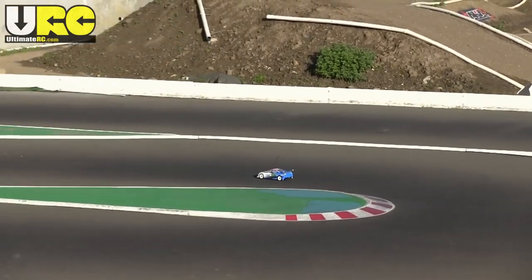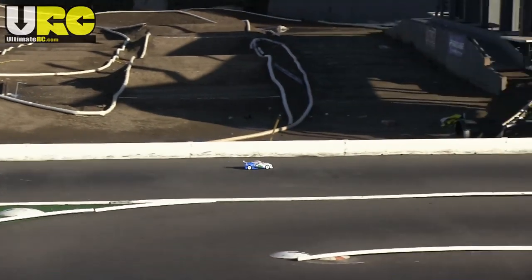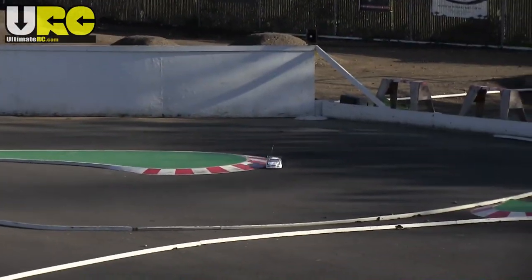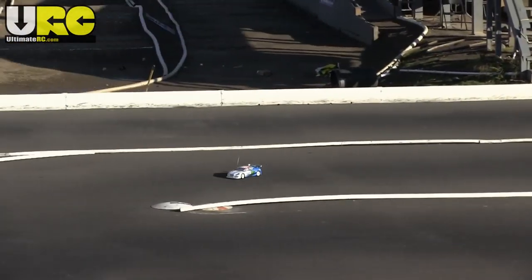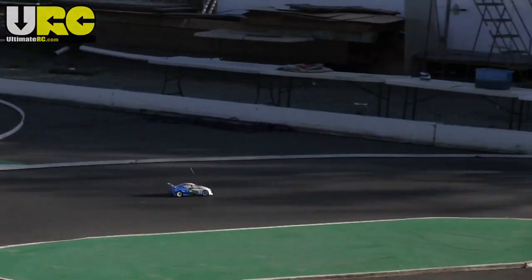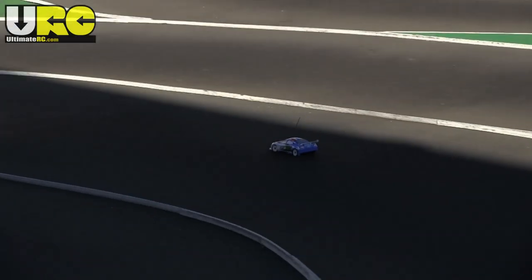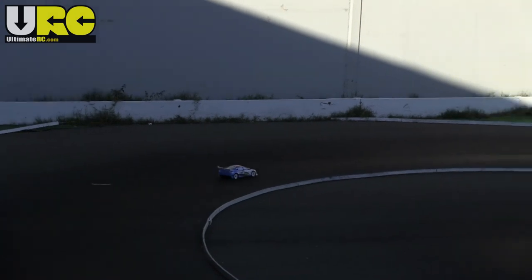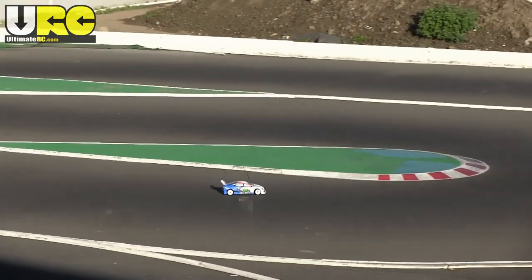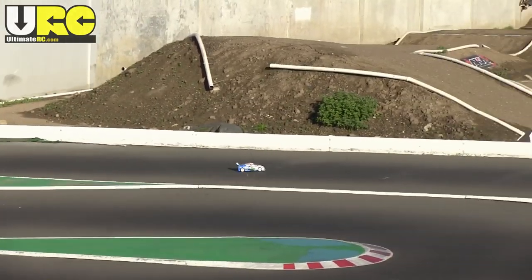Here I've also swapped in and warmed up some racing slick tires. With this gearing, it's now topping out at a whopping 23 miles per hour, giving me little to no noticeable difference in low-end acceleration, but a little bit more speed on the back straight. In this case, the new tires are giving me more additional traction than is needed to handle the extra speed. With better tires, I was also able to more easily see the front tire scrub. With no front shock absorbers and high static friction in the kingpins, the front tires actually chatter across the ground. Gripping, letting go, gripping, letting go.